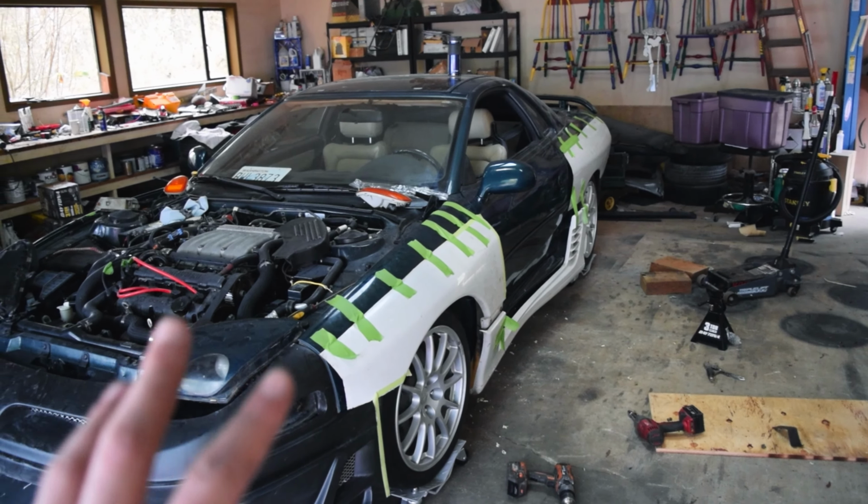There was a slight mishap on my part where I cut too much off initially from the metal, and so the slats had to be hammered back a little bit, but it's all going to be covered and won't make a difference. It just could have been a little bit smoother on my part. Nonetheless, we're going to weld over that and then use fiberglass filler and just normal filler as well to sand that down completely smooth, so there's not going to be any issues with that. It'll be completely sealed up. That's really just a non-issue, but still could have done that a little better. Nonetheless, again, it's not going to be an issue at all.